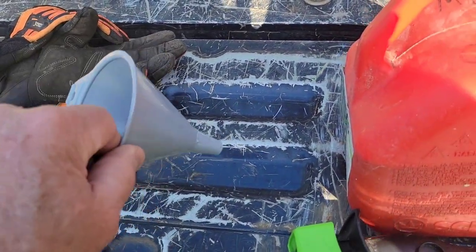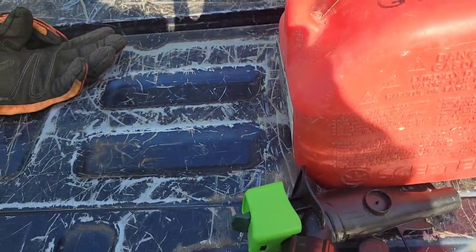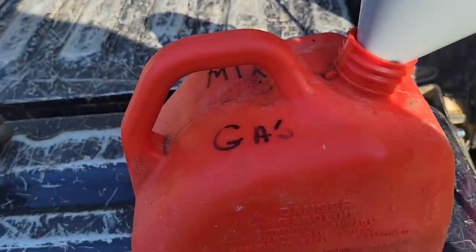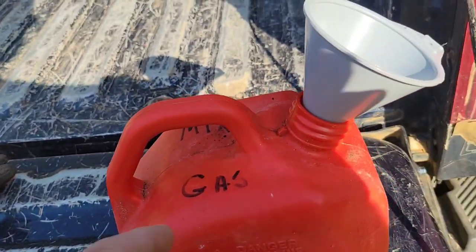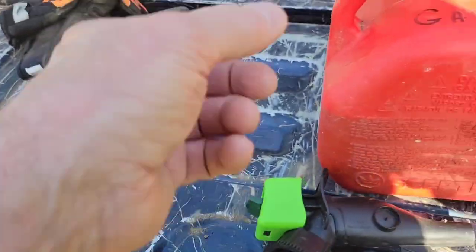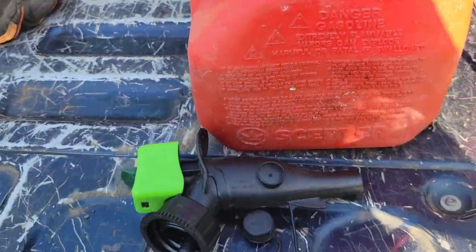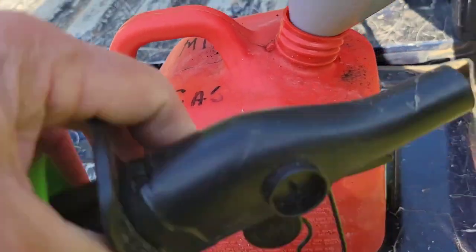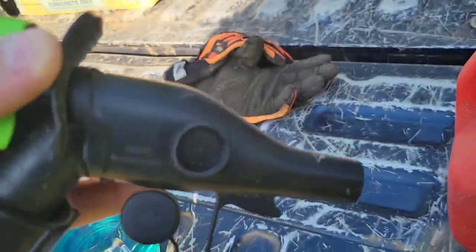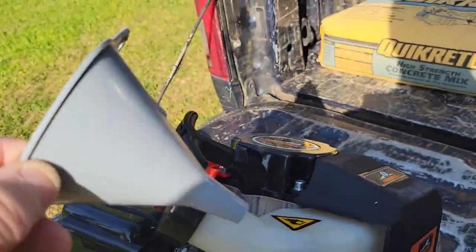When I did my mix, I had to pour it out of the original can and into here using a funnel, because this garbage spout don't work. It won't work — you make a mess trying to pour it out and get it all over you. So I take the lid off, put the funnel in, pour my regular gas in, go real slow up to a gallon, then add my two-cycle mix, pour it in, shake it up, and I got me some two-cycle mix. But now I gotta take the lid off again because this crap — you sit there mashing it in, trying to force it, and gas leaks out the side.